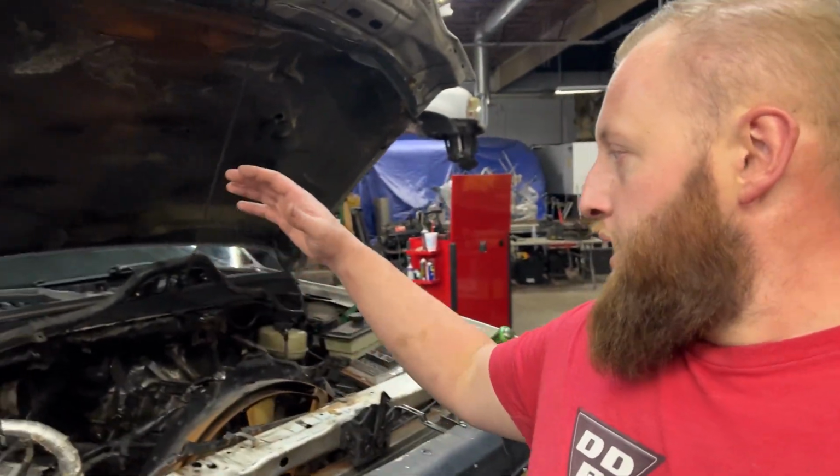So next video, we're going to go ahead and get the valve covers torn down. We're going to get the injectors out because I'm going to want to reseal those with the heat that I've seen, the browning on the plastics on the oil system. Definitely don't want to take a chance having an injector seal blowout on the oil side.